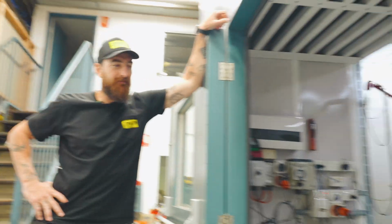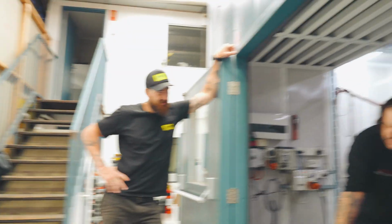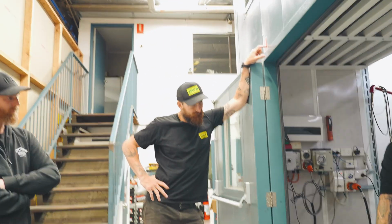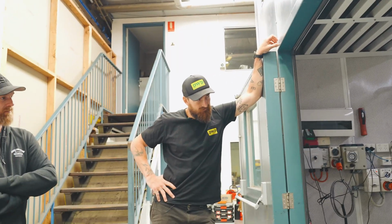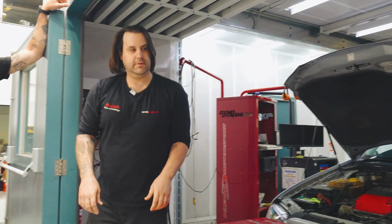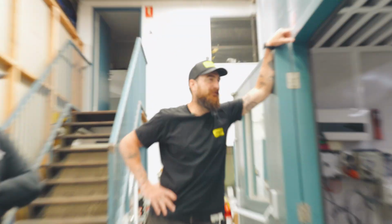What do you reckon, 15 pound? On the BAs, 15's healthy. Over that, it's sort of stressing the rods a bit. But if I hold it flat at 15, it's amazing. It'll sing the whole way, so every gear change will be on peak boost all the time. Well, that's good. So we're going to go like 350?